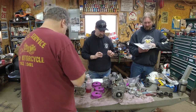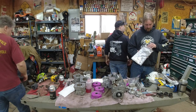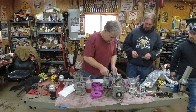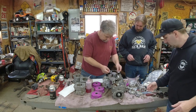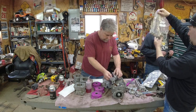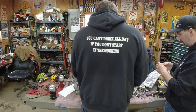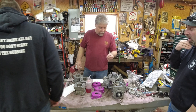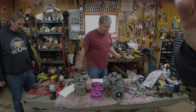All right. A little thin film on all those. Three bond? Nope. No three bond on the base gaskets. But these base gaskets, oh, we got the one stud that came out. Oh, we got to find that stud and get that threaded in, too. Oh, okay, there it was. Right there. I didn't see that. So the base gaskets aren't symmetric. That's what I've noticed. So there is a definite right and wrong way for them. Right here. Yeah, we should find a new bolt for that, or at least tap it again. It got pretty beat up. You're blocking the camera, Brad. That's the way it goes sometimes. All right. I'm going to clean up these threads and we'll come back. You want to pause her?